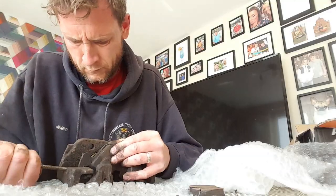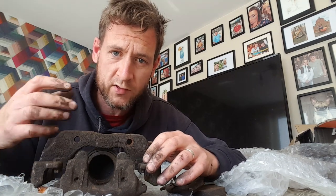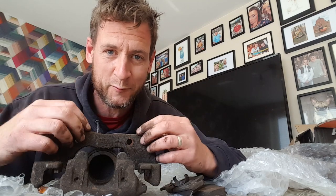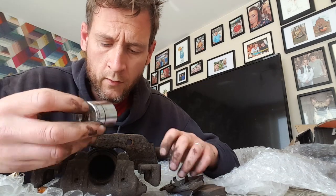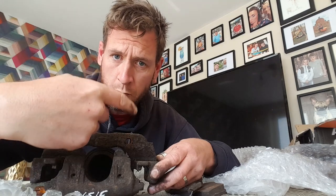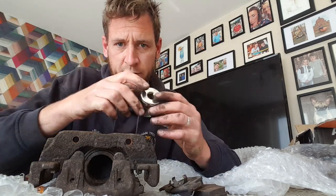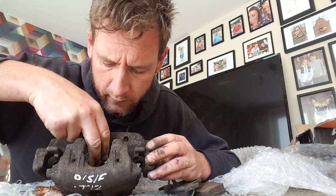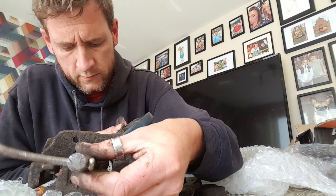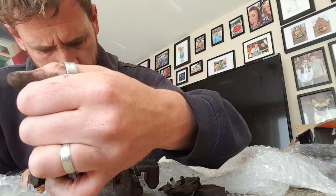So I've got a G-clamp, we'll get these pads out and we'll try and compress the piston. Right, so now the pads are out we can see the piston on this caliper. What I want to try first of all is to compress it before we attach it to the car, in case this one also doesn't work. As well as this G-clamp, what I'm going to be using is a socket. The idea will be that we put this socket into the piston — when I then put the G-clamp onto it, it will put an even spread of pressure across the whole piston so that the piston itself isn't going into the caliper at a funny angle. So we'll put that in now, drop that in there, wind the G-clamp into position, attach on the back, and turn this until it gets onto the socket itself, then gently turn.